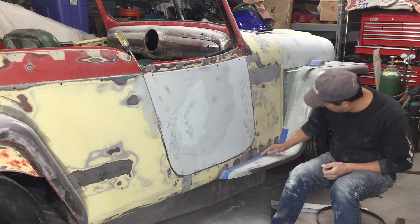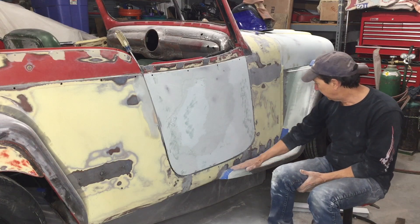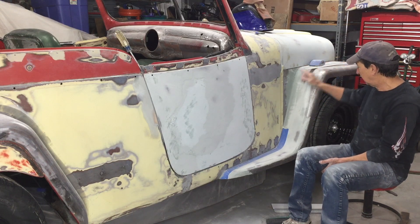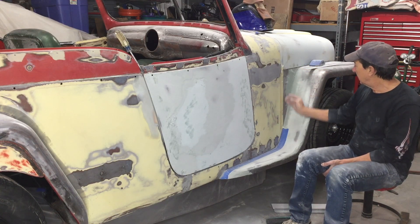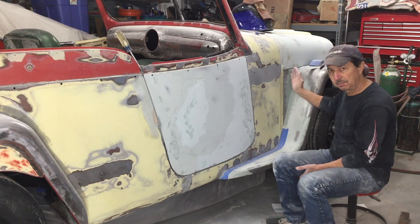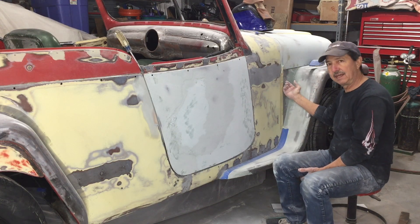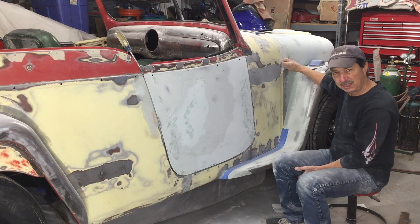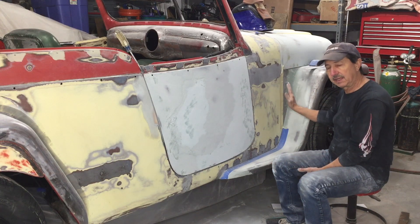Now that the all metal has cured I'll be able to take this fender off, get it all contoured to fit perfectly, and then come along this edge with filler without having the fender on. I put masking tape on here just in case there was a really bad line because on the other side it was kind of off, but this side's perfect so I don't need it — other than this area. Before I take it off I'll put a coating along here. I put tape and paper on so that if any filler oozes in between those panels it's not going to bond them together, then I can peel it back and fill this side without bonding the two together. It's kind of like a parchment wax paper thing, then I'll be able to get that out, sand them down, and not have to worry about that edge anymore.